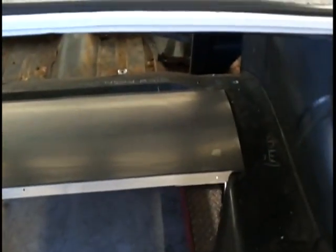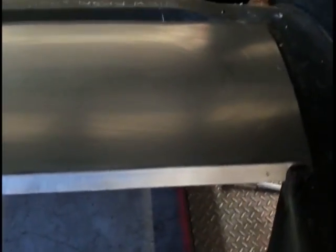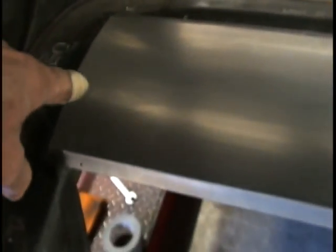Okay, we're in the trunk now. I've taken the top pan and I've laid it in our opening. As you can see, it fits in only one place. The corners will locate it. It goes all the way back against the ridge in the rear. At this point, I take an 1/8" drill, in a drill motor, and I drill locating holes on either side to hold it in place.